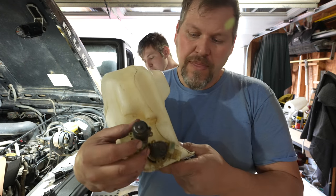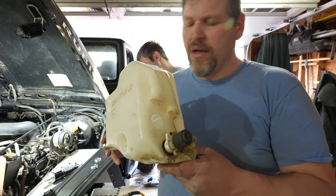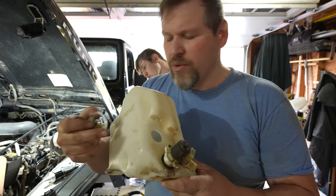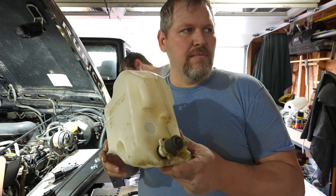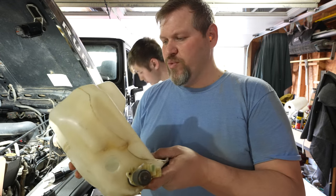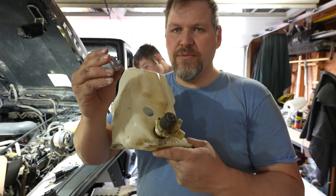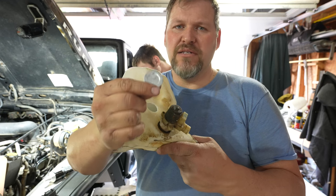So this thing actually has two pumps — one for each windshield washer. This is the one that was primarily giving us issues. We took it out and we're going to relocate it. I actually have a plastic welding tool that welds nylon, which is pretty much what this is, but the nylon rods I have are too big for the hole. So I went up to Home Depot and picked up these — they're electrical box knockout fillers.